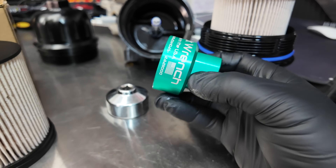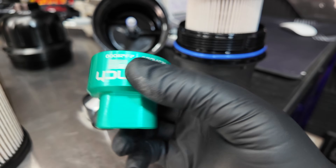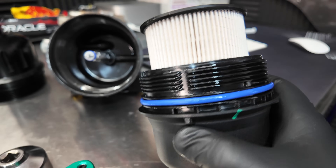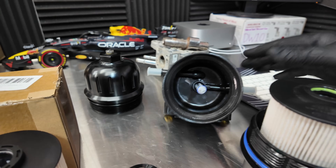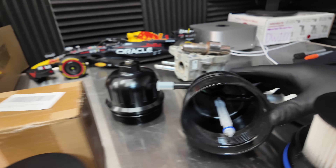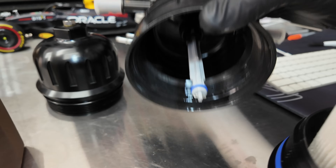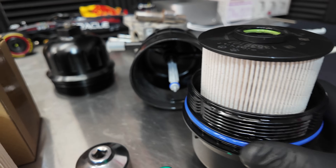In order to get it torqued correctly, I use a click wrench — I absolutely love these. Super easy, it's a 3/8 drive. You just pop it on and tighten it till it clicks. There's nothing wrong with using a standard socket and a regular torque wrench, but definitely torque these down because if you over-torque them, they're actually going to seize up and that's bad news. If you have to buy a new housing, they're actually not even that expensive — I bought this one for about $70 off Amazon. This one is for the 3.0 Duramax diesel. It also comes with the heater assembly and the water and fuel sensor, so it's not bad.